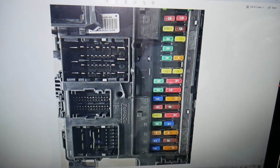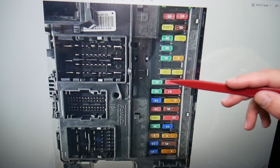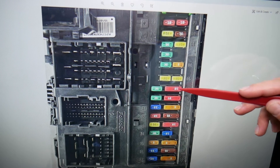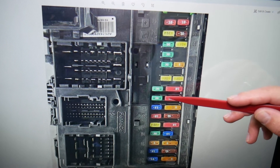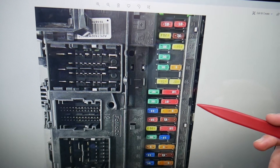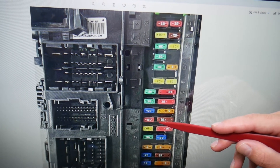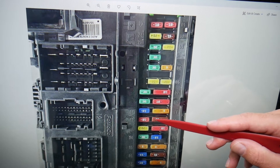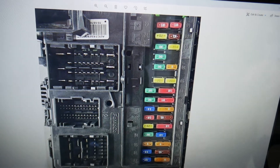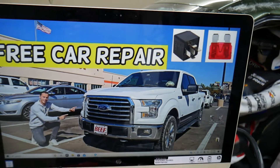In that row of the interior fuse box, count positions one through seven. There are also double fuses — 10A/10A — at positions seven through eleven, then fuse number 12 and 13. Fuse number 12 is a 7.5A fuse that needs to be checked as well. Fuses 12 and 13 are practically one double fuse. Hopefully this video is helpful — thank you for watching, see you next time.